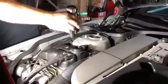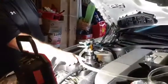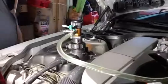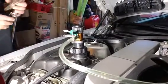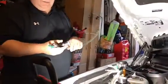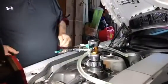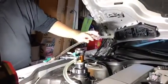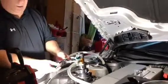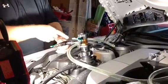Then we're going to put the filler in. So I already put the valve on it and the rubber coupler. I use 45mm just to see if it's tight and seals, because the point is to seal this so the vacuum can be effective and not leak. Now we're going to put the venturi, which is this piece, okay? Now this line we're going to put in a bucket or something, somewhere to drain whatever excess we can come up with. And in here we're going to put the compressor line, the air line, and that will create the vacuum.